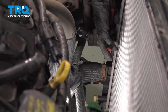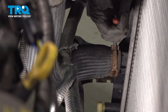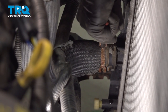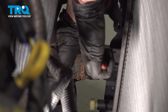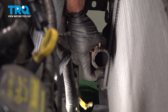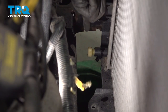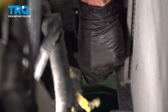Follow the radiator down to where it connects onto the lower radiator hose. You'll find another clamp — give that a quick squeeze with some pliers. Rotate the hose around and remove it from the lower aspect of the radiator. Make sure it's soft, pliable, and not torn or worn. Set that aside. Once you have that off, continue on to tightening the drain — snug this up so the radiator does not continue leaking out.